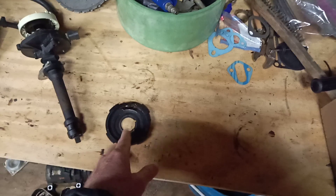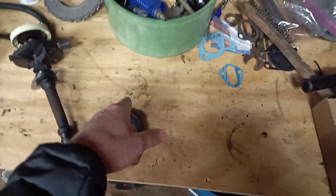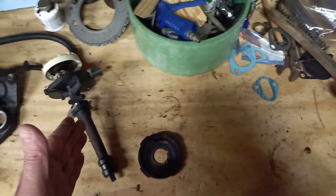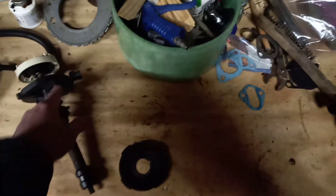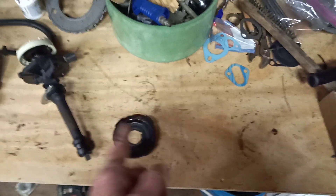With a single rotational crank sensor you only have resolution of 360 degrees — you can't determine if you're in the first 360 or the second 360 of the engine cycle. However, when combined with the cam sensor and that half-circle shutter device, since the cam and distributor rotate once for every two engine revolutions, you now have enough resolution. During the first 360 the cam sensor will be on, and during the second 360 it will be off, giving you 720-degree resolution combined with the crank sensor.